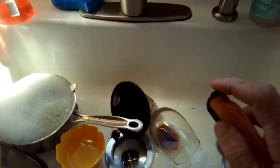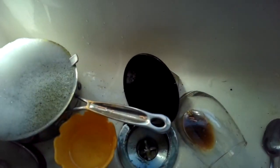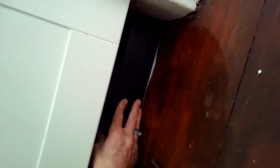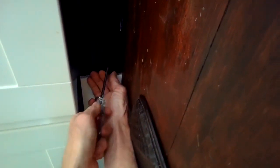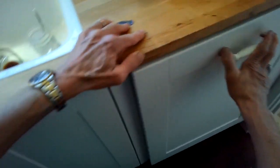Now I'm just listening to it at the sink draining — that sounds good. These guys will be happy to do dishes again. Last thing is we just put that panel back in, put the insulation behind it, get it in position, and then put these little pieces in and take a standard head screwdriver and twist them just 90 degrees to lock them in. KitchenAid is actually made by Whirlpool, so this would work for most Whirlpool dishwashers. Some of them you have to remove the dishwasher from the cabinet to get to the drain motor, but this type is great because it's just sitting right there, easy to grab.